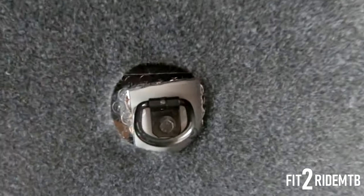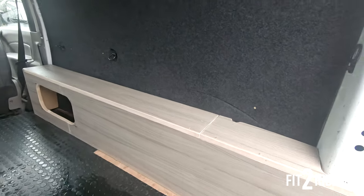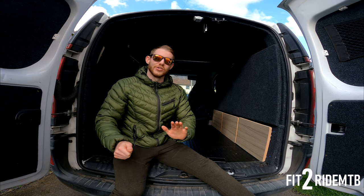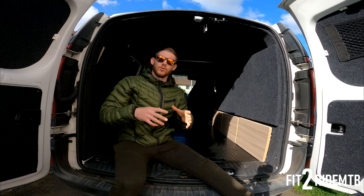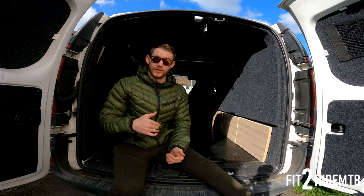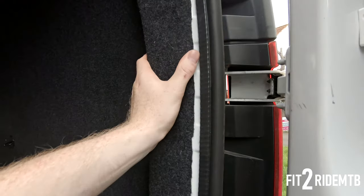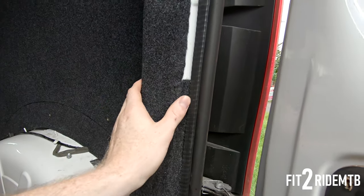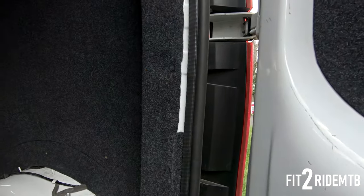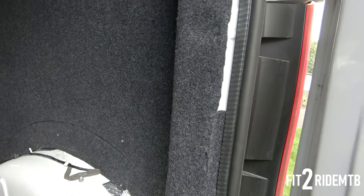All you do is use the spray adhesive that comes with the carpet — you spray it on, it's like a webbing, and then you apply the carpet. It's a little more forgiving than normal house carpet because it does stretch. Make sure you've got some tension throughout the carpet and go bit by bit rather than trying to do a massive piece in one go. Also, if you're carpeting the whole lot, start from the top and work your way down. Wait for the adhesive to set before moving to the next part. If you've messed up the side, cut another strip and push it underneath the fold, overlay it over the top, and use a Stanley blade to cut straight down.